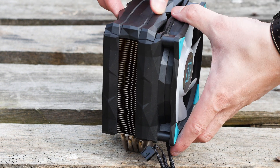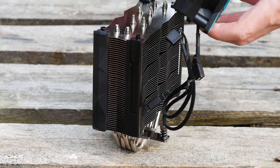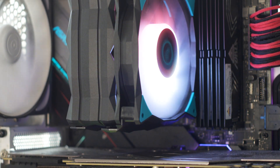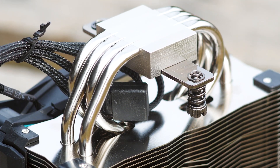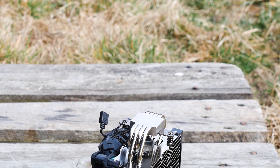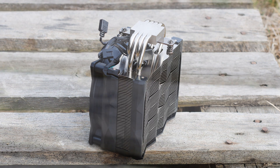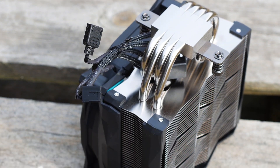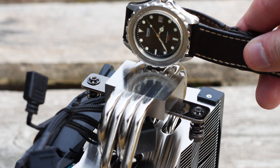This mounting system is advertised as good for increasing RAM clearance by lifting the fan out of the way, but this is a cheap solution for a problem that shouldn't exist on a CPU cooler in this price range. Moving on, the baseplate is flat and made from nickel plated copper. While it looks great, it is a direct touch heatpipe baseplate, meaning the heatpipes are integrated into the surface of the baseplate. This type of baseplate is commonly found on cheaper CPU coolers and is regarded as inferior in terms of heat dissipation, as the heatpipes and baseplate have small gaps between them that affect cooling.